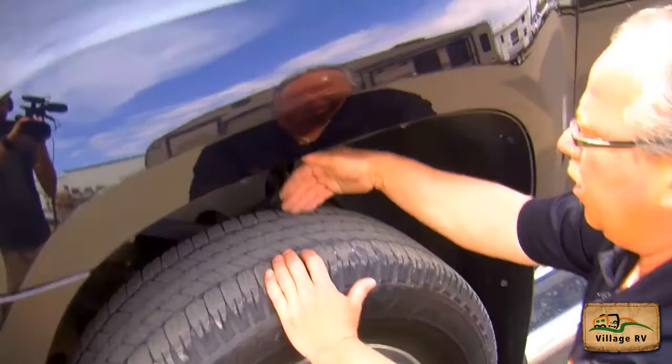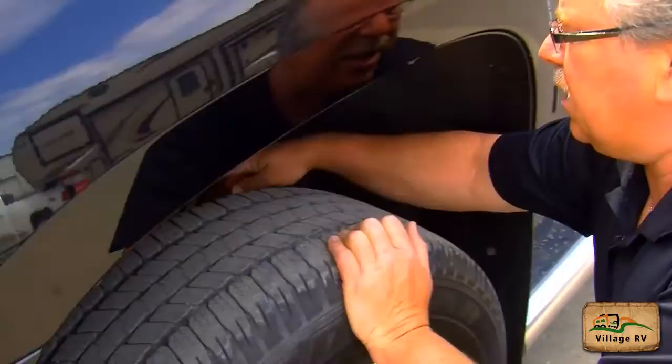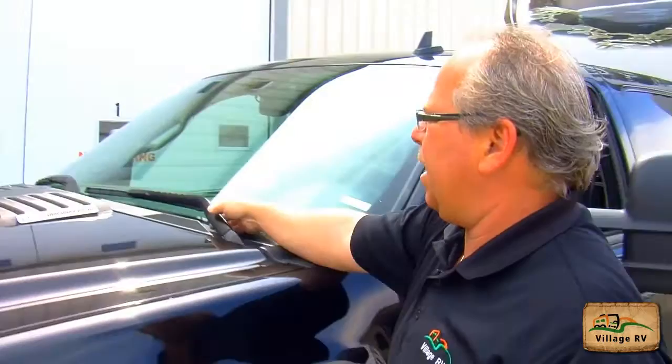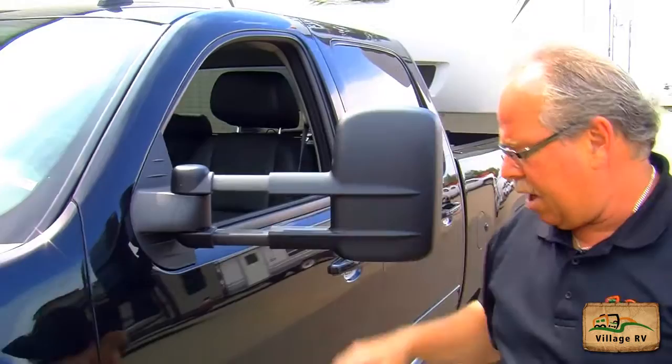Coming to the front wheel well — I've got lots of tread in my tires. I have no cracks in my sidewall, no cracks in the rim. I checked my lug nuts and the air pressure this morning — everything is good. My suspension is all in good shape. My brake hoses are all fine with no cracks or leaks. My inner tub is secure. Mud flaps are secure. Standing up, I grab the windshield wipers — they're in good condition. My windshield has no cracks or chips. My mirror is secure.